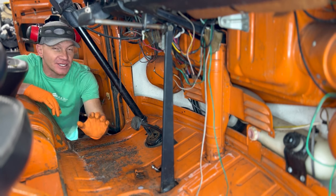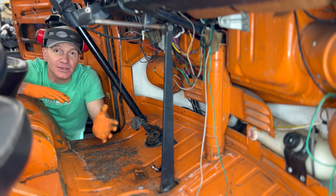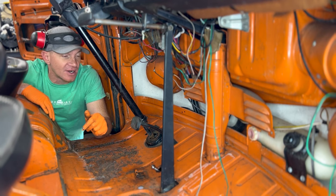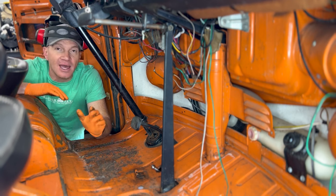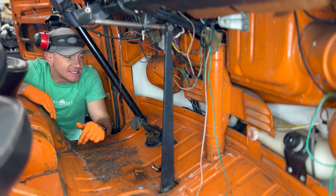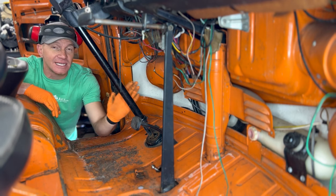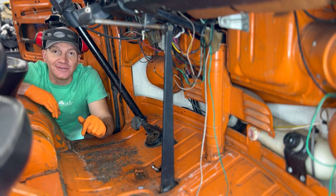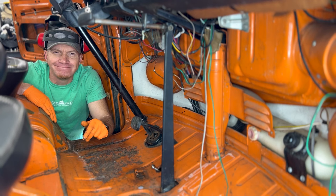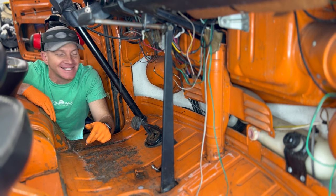The last piece of that is the steering coupler. These are almost always 50-plus years old depending on the age of the bus, almost always original, dry rotted, cracked, and to be totally blunt — they're dangerous to drive with. We did a PSA video a little while back but didn't actually show how to do this, so this video I'm going to roll through pretty quickly and simply show you guys how to change the steering coupler, sometimes called the damper, that connects your steering column to the steering box itself — so that you can A, be safe, and B, have fun.